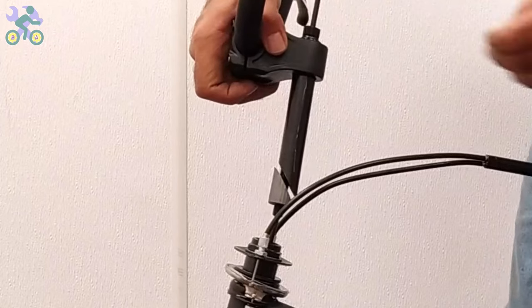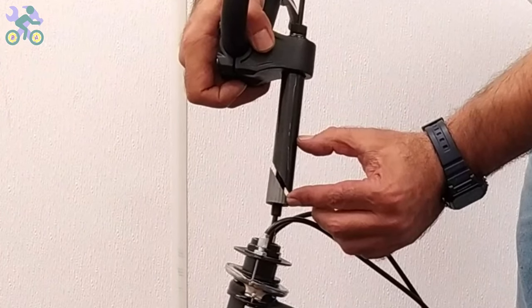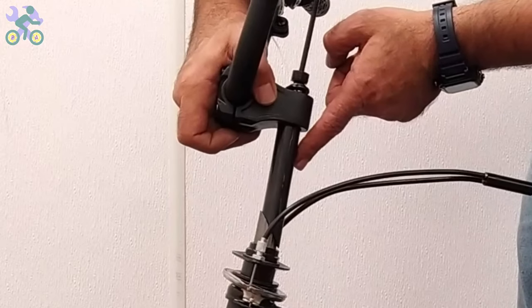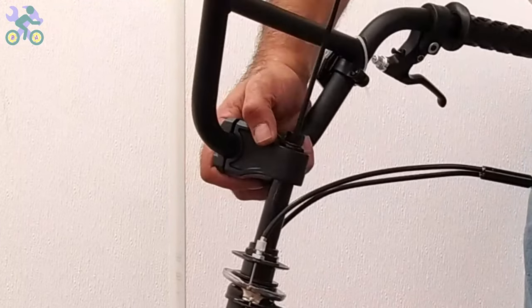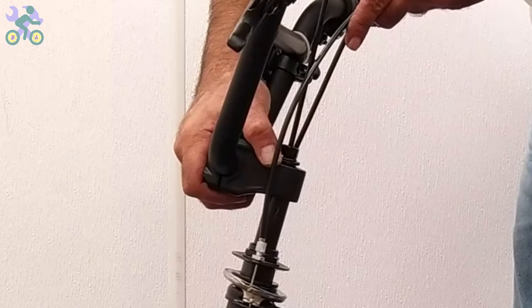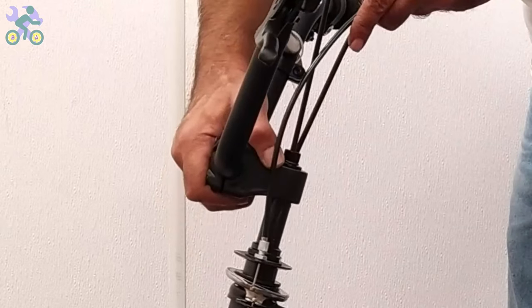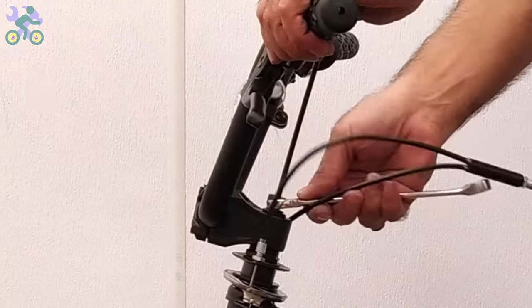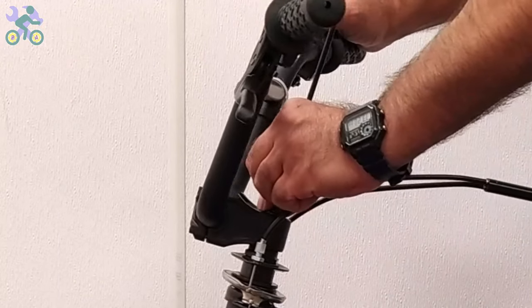The height of the handle is adjusted. You can increase the height by up to half the length of the stem rod. Look for a specific mark or color on the bar to indicate the maximum height. For safety, the mark on the rod must be inside the tube. Align the tire with the handlebar and tighten the screw on the stem to secure the handlebar in place.